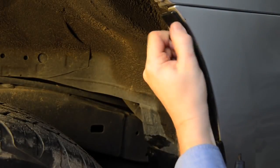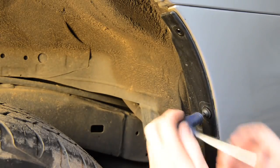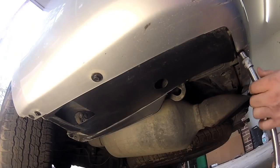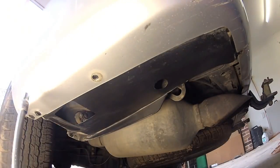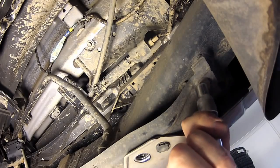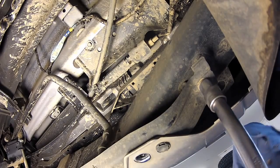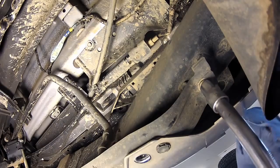The first step in the installation is to remove the existing plastic bumper. Begin by removing the screws securing each rear mud flap inside the rear guards, then the 3 bolts attaching each plastic splash guard underneath the bumper wings. Moving around under the rear of the bumper, you can then remove the 2 bolts attaching the pressed metal bracket to the chassis. The bracket will come off with the bumper.